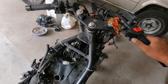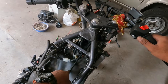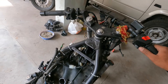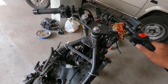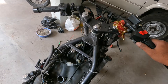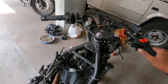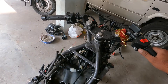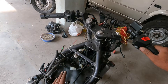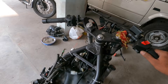What happens is the spark plug doesn't come out with the socket, so you need to insert the spark plug cap once more and then pull it out. The spark plug gets attached to the cap and it comes out. After that, you need to insert the new spark plug with the help of the socket and then turn it clockwise. Once it is hand-tightened, put in the socket extension again and turn a quarter — or just a bit more than a quarter — with your hand. It will go in completely and be seated. Once you feel it is tight enough, take everything out and pull back the flap.